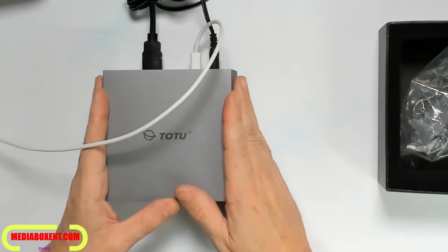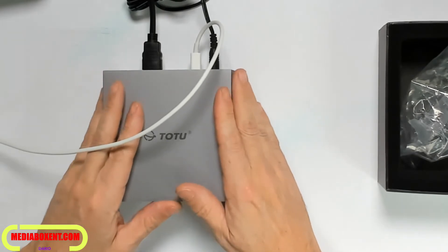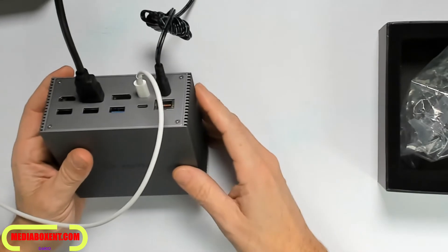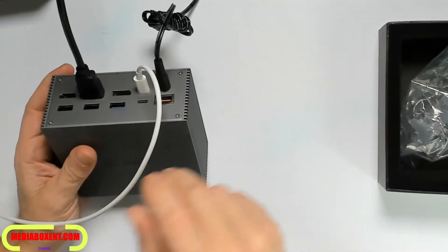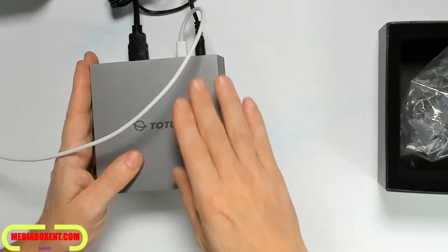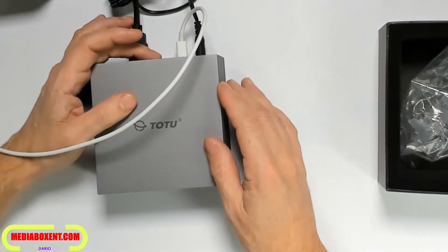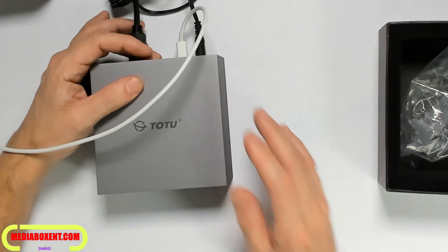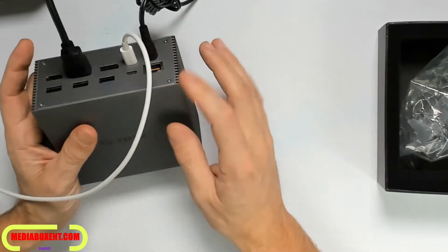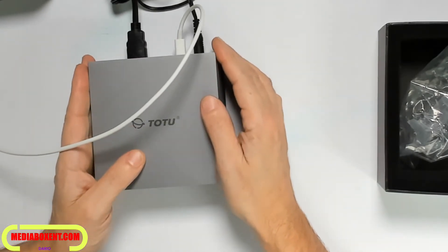When you apply the HDMI cable, depending on how many screens you have — when you connect a screen, one of the displays will be a 4K display. You can plug in via DisplayPort for 4K and the second screen will be 1080p, or you can do HDMI 4K and then 1080p on the DisplayPort. If you connect three screens, then all three screens must be set to 1080p 60Hz.